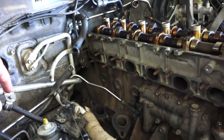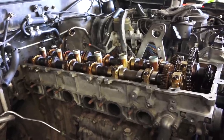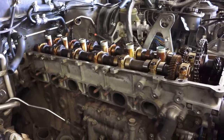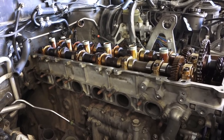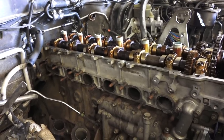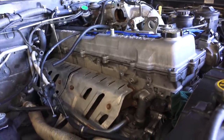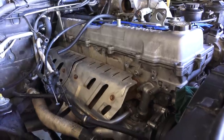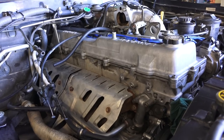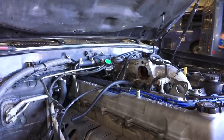It's basically putting the cap on, putting the intake and exhaust manifolds on, and then just buttoning everything back up. We will attempt to start it and hopefully everything has been done the right way. A couple or three hours later, the manifolds and shields are on, and the intake manifold is installed including all the EGR in the back and all the messy stuff.